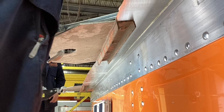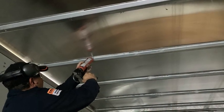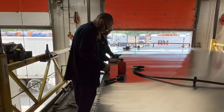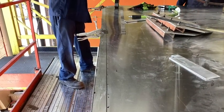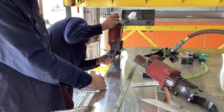Now that the roof section is secured at the rear, let's go back up front to our stretch plates, install the come-alongs, and tighten up the roof just enough to where it has a little bit of bounce in it. Because the section was so large, we will now go inside the trailer, slightly push up on the roof, and caulk the roof bows. The next step is going along the left and right side of the trailer, marking the holes in the roof sheet using your fabricated hole finder tool and a hammer. Then go along both sides, using your punch bit or drill bit, drop in the rivets, and squeeze them with a rivet squeeze gun. Now that you're up front, relax tension on the come-alongs and remove the stretch plates. Our top rail had holes already; our new nose rail does not, so we have to use our hole punch tool or a drill to make those holes, drop in rivets, and squeeze them tight.